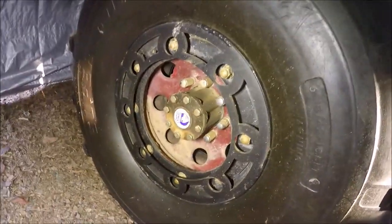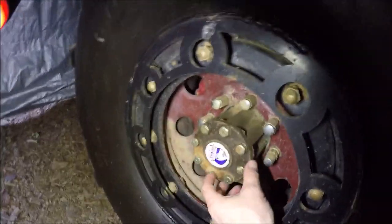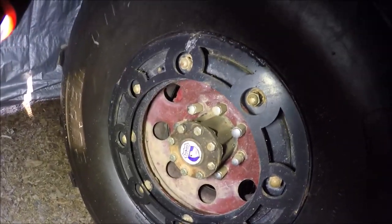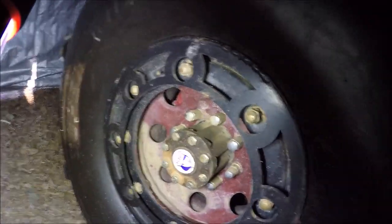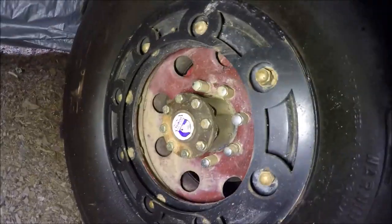The more desirable and stronger design is the full float. You can see here — that hub there on the Dana 44 — the axle shaft itself is bolted in. So if I took all eight bolts out, the axle shaft would actually slide out and the tire would still sit there and still roll, because the weight of the Jeep is on the hub itself with the bearings in there. This is stronger because the power is just transmitted through the shaft — it doesn't have to hold the vehicle's weight. Big trucks, dump trucks, 18-wheelers — they all have the full float design.